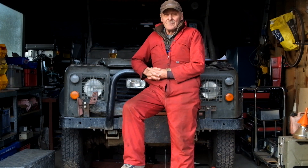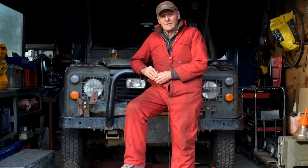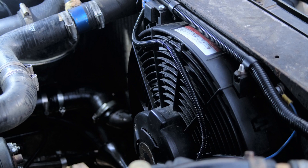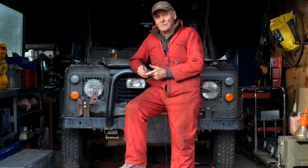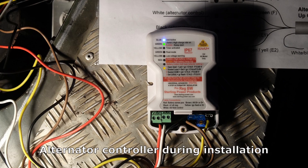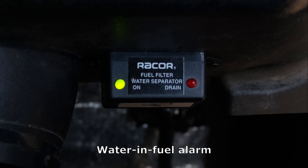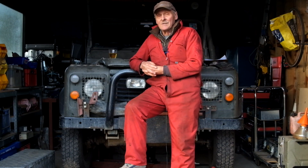The main battery systems present a big problem: the provision of extra circuits. These include the electric fan, the fuel lift pump, the air horns — which can't be powered by the existing horn circuit and are needed for some countries — the alternator controller, and the split charge controller. Most of these need their own power, albeit low power demand, and the list soon builds up.